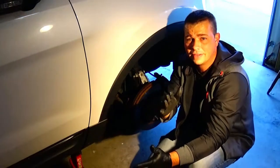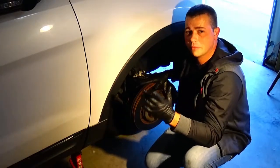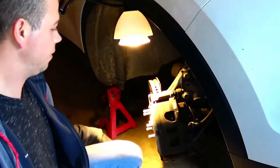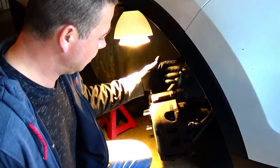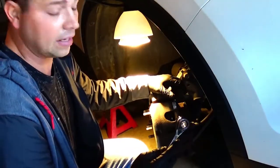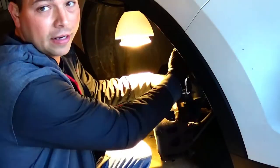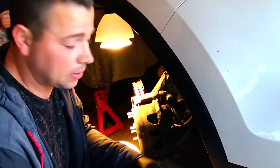The tire goes behind the axle under the front end of the car. I'll take the other one off and put it on the other side, so if the car comes down it's got two rims to sit on — that takes away a lot of the chance of serious injury. The next step is to take off your brake caliper. There are two bolts, one at the top and one at the bottom, and I'm using a 11/16th socket.